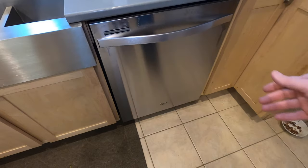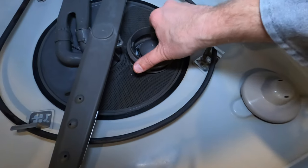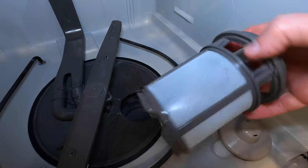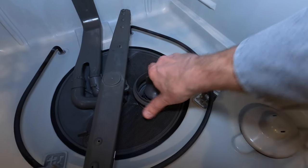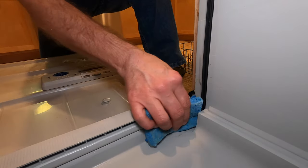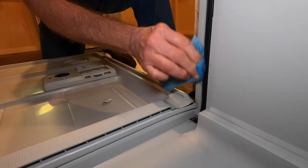Clean your dishwasher? Who does that? You're supposed to do it. Mine is a Whirlpool and there's a filter on the floor of the dishwasher that you have to turn counterclockwise to unlock and then pull it out. It has a screen and mine was packed with slimy food. Clean and scrub all that gross stuff off the screen, put it back in, lock it in, and then I took a rough scrubbing pad with some Dawn dish soap and scrubbed the rubber seal at the base of the door where it hinges when you open it. Scrub both sides of the seal — the side facing you and the opposite side — and Dawn breaks down the greasy stuff.